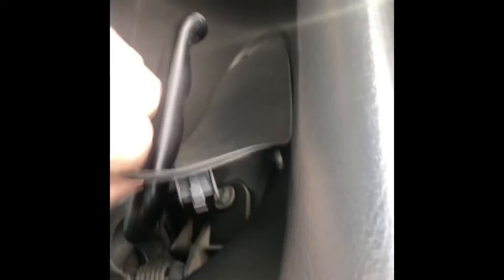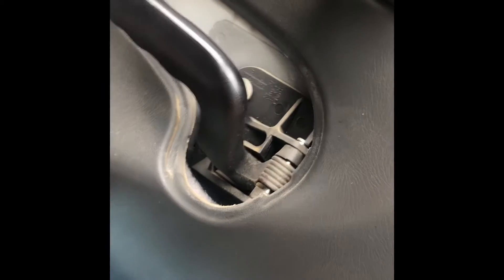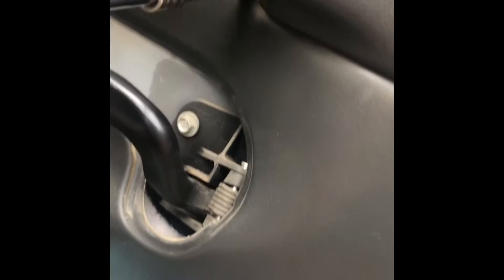We're going to be popping this off and pulling it out. There's a 7 mil up there, so we'll be taking that off right now. Once that's backed off — now, for the '06s, I've noticed that on older models from like '99 to '02, there aren't these plugs here. But for the '06, I believe on this one there's a push clip on this side and a 7 mil on that side. As you can tell, I'm pulling this out right now — it is an actual push pin. I did get the clip off on the right one, which is this one right here.